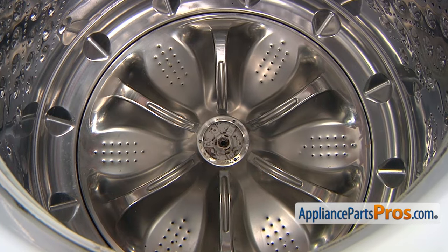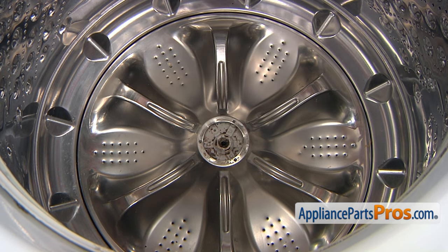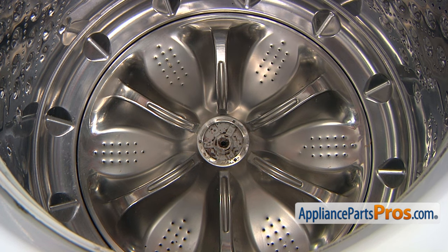After that 10mm screw is removed from the center, the pulsator assembly supposedly will come out easily — but not in my case. I tried every possible trick that I had up my sleeve, including a heat gun, rust buster liquid, and a puller, and it's still there.